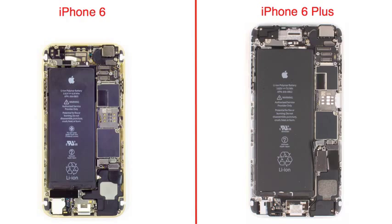As I said at the beginning, although the iPhone 6 Plus may look like an oversized 6, there are some significant differences inside the case. The overall layout is very similar but not identical — for example, the vibration mechanisms are different and located in different spots. Likewise, the external speakers are different. The Plus's 11.1 watt-hour battery is also much larger than the regular 6's 6.91 watt-hour unit, and the logic boards are different.